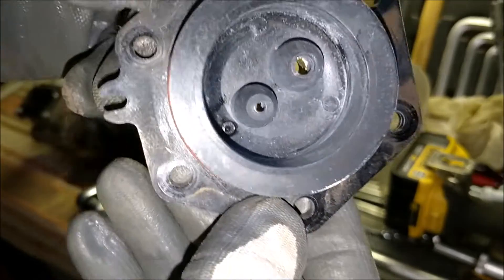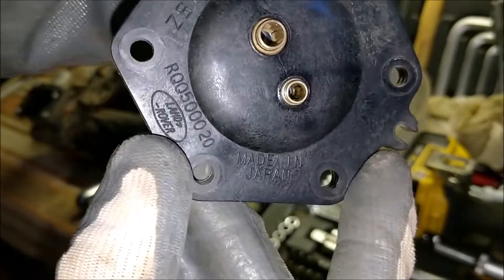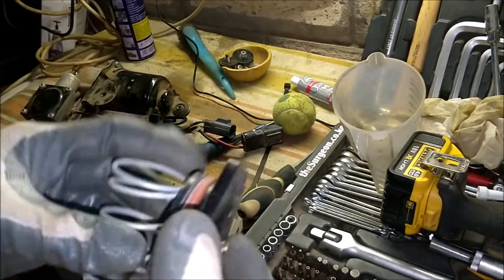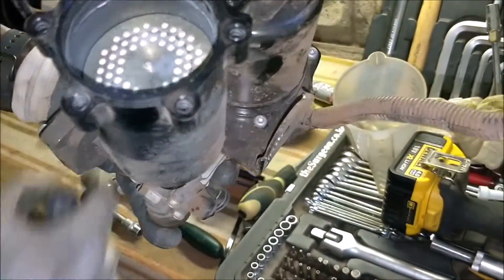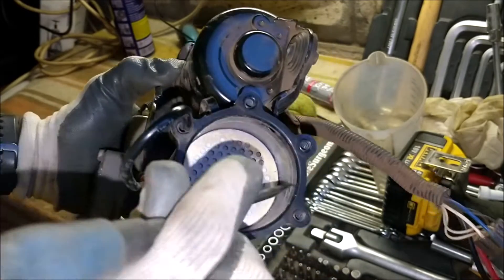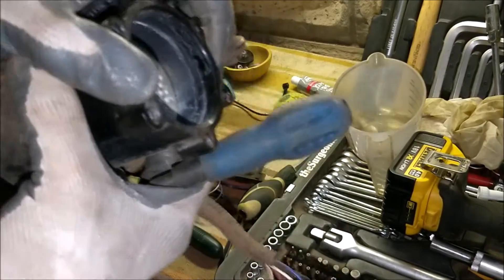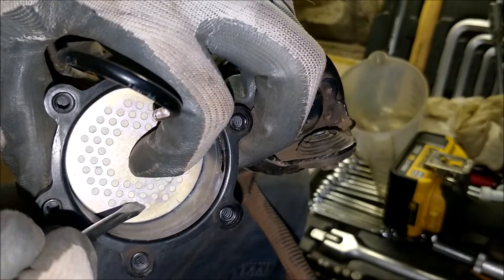As is typical with compressed air systems there was some moisture in there — that's perfectly normal. We can confirm that the crack goes all the way to the inside of the cap: there's that line on one side of the crack, and this side is also evident. I'm not sure if this would be enough to cause the sort of leak the vehicle dynamics is complaining about. Over on the other side is the dryer, and there should be some drying agents in here — silica gel balls of some sort.